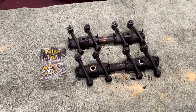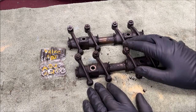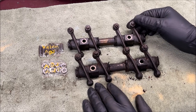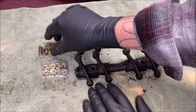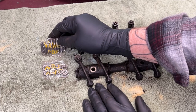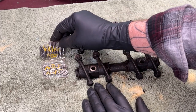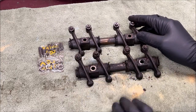Something I did want to bring up: whenever you're doing this it's never a bad idea to have new studs and new nuts on hand and put new fresh ones in your rocker arms. A lot of times these strip out or become frozen - they're something you should replace once in a while because they do get worn out. Thanks to Save the V-Dub, the gentleman doing the Stroker Motor sponsorship - I can't thank him enough - he sent me a complete rebuilt kit of nuts, bolts, and everything. So we're going to put new adjusters and new nuts on them also.